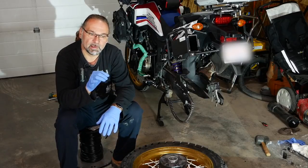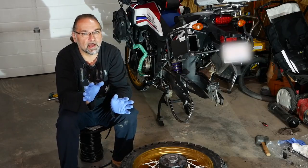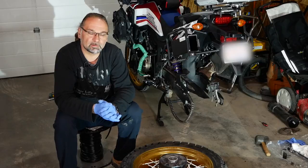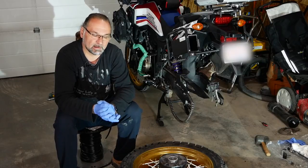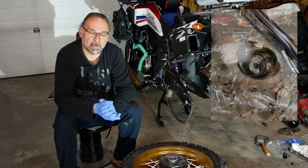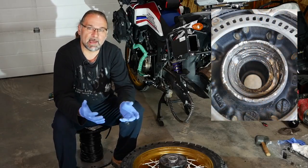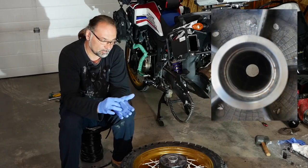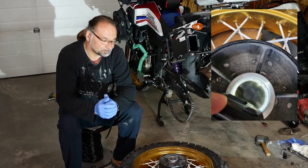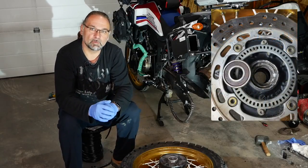Don't wait for the last moment to change your bearing. I would say change them probably around 20,000 to 25,000 kilometers if you're riding off-road. Yesterday it took me about four hours to yank that bearing out — I had to grind it out and I mangled up the hub a little bit. I'll show you how to remove bearings when they're still intact, because it's much easier to take out a bearing when it's not shot.